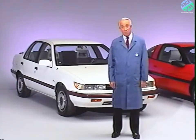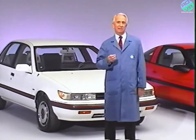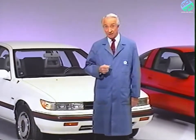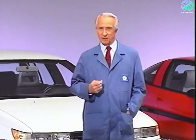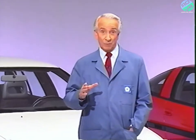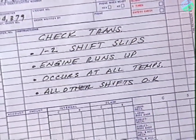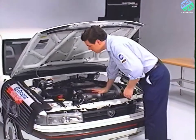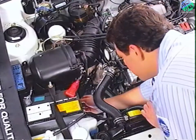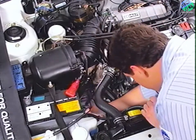The KM175 and KM176 four-speed automatic transaxles require a detailed diagnostic procedure. A thorough diagnosis is critical to a fast, effective repair. Many times, a simple cable adjustment is the only action required. We can break the process into four areas. First, a complete repair order is essential — the service writer should note all customer comments and ask questions to get a better look at the conditions under which the problem occurs. Second, perform a thorough visual inspection, including a road test. Be sure the control cables are properly adjusted.